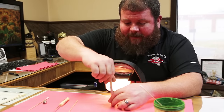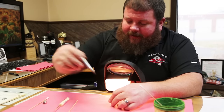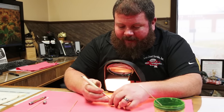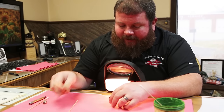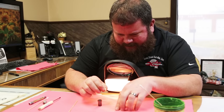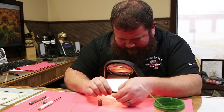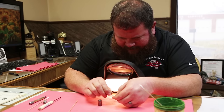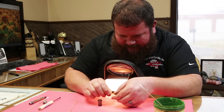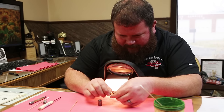They don't leak. The spray pattern is reasonable. The opening pressure is remotely correct. The level of tolerance here is going to be probably greater than we would normally like to operate within, just based on the availability, right? And with this being an indirect or pre-combustion engine, the spray pattern maybe doesn't have to be exactly perfect. We certainly shoot for perfect, but if you've watched any of John's videos, I think this whole machine has a long way to go before it's perfect, but perfect is the goal, as per usual.